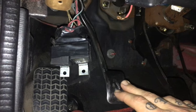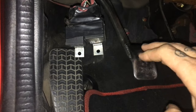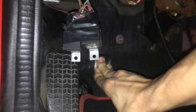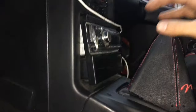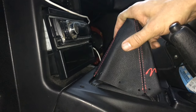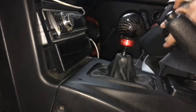We're here with the Miata and we have a bit of an issue - there is free play. The clutch engages about right here and it's just real soft; I can feel it's not fully engaging. When we go to shift, the clutch isn't depressed all the way - it's still slightly engaged, and especially under any type of real heavy load it just wants to grind. You can feel it and it's definitely not good.